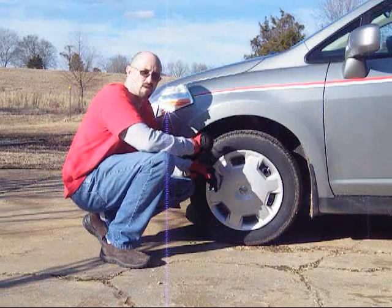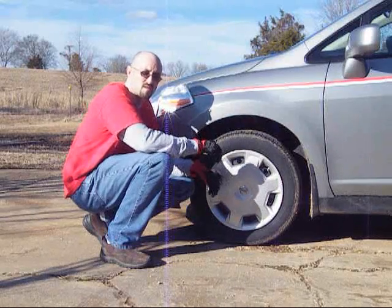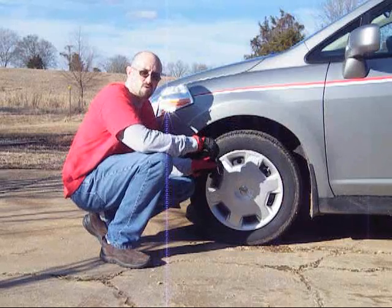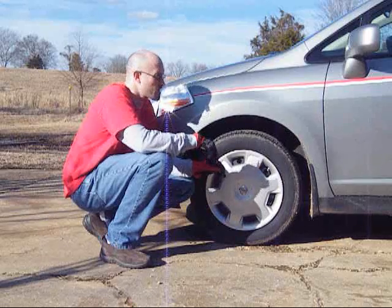If your light comes on and one of your tires is low, I'd recommend putting it up to roughly 33 PSI, as the sticker in the door jamb shows you. Or if you need to go higher because of altitude or temperature, take that into effect.